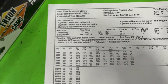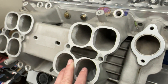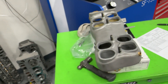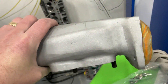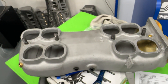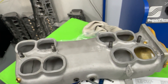Anyway, some cool facts to share — really a unique project. For you Iroc guys or Corvette guys with some time and energy to invest, it might not be too bad. It would be very interesting to see on the dyno. If you put this on with two carburetors, plug the injector holes so you don't have an air leak, then put that top on — how much power would you have lost? And I didn't say gain — I said loss. There's also the issue I haven't talked about: air distribution. I didn't flow the back cylinders. I did a video where I flowed a tunnel ram on an alky digger with a butterfly injector, and I flowed the first and last cylinder — it was a lot of difference.